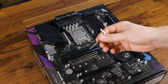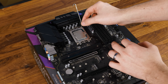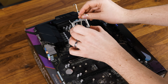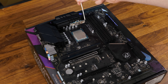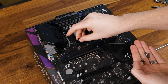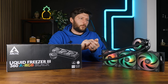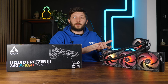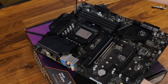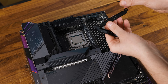To get the cooler going on Intel, place the motherboard onto something that provides back pressure against the socket, make sure the CPU is installed and the socket is open. Then place the Arctic contact frame with the arrow in the bottom left corner, use the new Phillips-head screws in an X pattern, a few turns at a time, until everything is screwed down. If you have trouble catching the thread, it helped to lift the motherboard and wiggle the backplate a bit freehand. Over on AMD it's much easier: remove the original retention brackets, replace them with the spacers, add the mounting clips with L and R readable, and screw everything down.